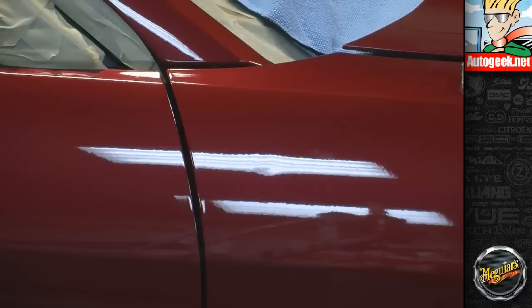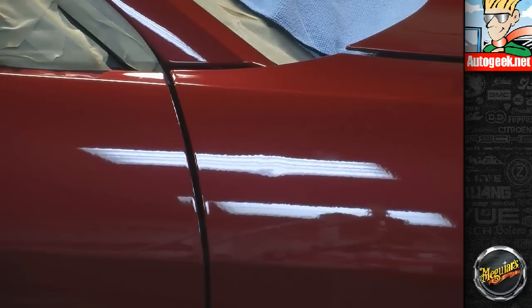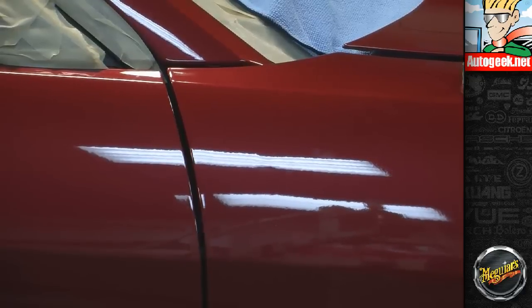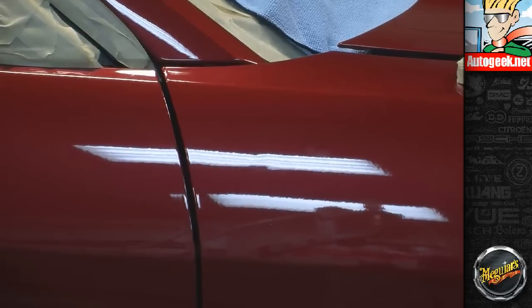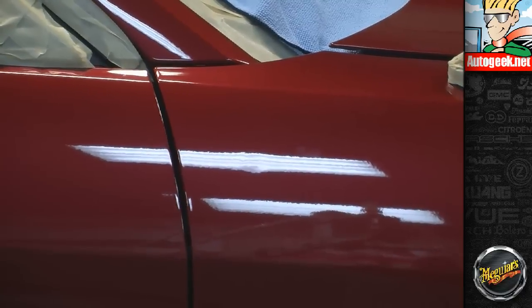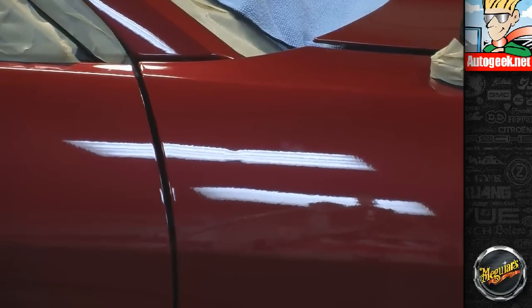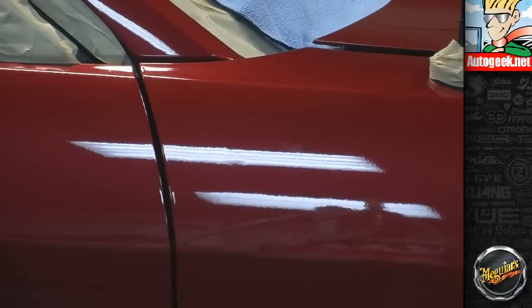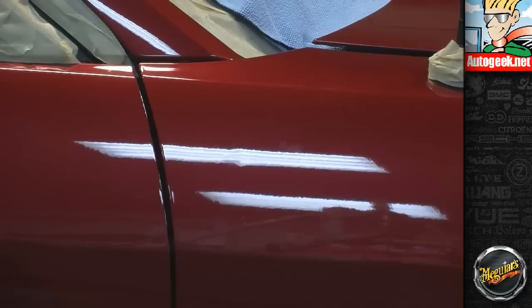And now see, the dent looks much different already, doesn't it? Yes, it is. It's flattening out. Yep. It's less concave, and now it's halfway gone, I'd say. Now keep in mind I'm using a 5/8 inch steel rod, so I'm putting a little more pressure on the dent than what it looks like. But it's very precise, exact pressure, exactly where I want it.